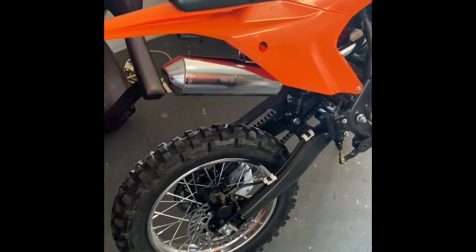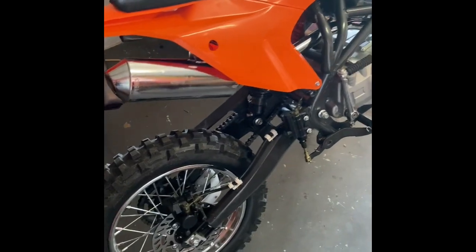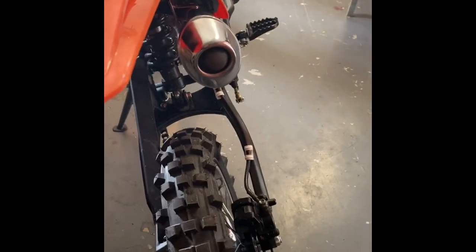Let me paint this, then I'll install it and let you hear what it sounds like on the bike. The finished muffler is installed back on the bike. The only real difference you can notice is if you get underneath the bike — this is just where I painted it with aluminum paint. It's not quite as shiny as the factory stainless steel but it's on the back side so you really can't tell, and it's sealed up good and will keep it from rusting.